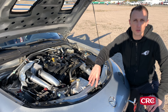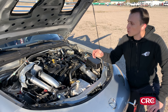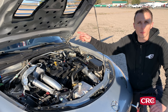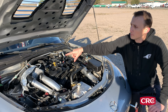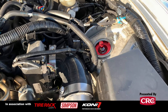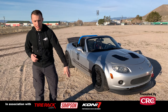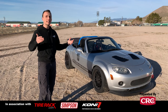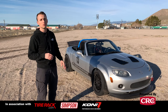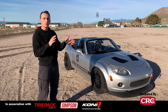We've got our Goodwin Racing triple-pass radiator down here, which is really important for cooling. To work with the turbo we have 800cc Injector Dynamics injectors and a Walbro 300 fuel pump in the back. There's also a Radium Engineering catch can over in the corner, and you can see the Meister club race coilovers up top. It's a relatively simple build — this car is about 300 horsepower conservatively tuned on 8 psi, and you don't need a long list of parts to have a lot of fun at the track.